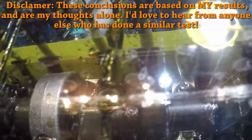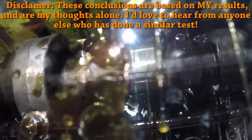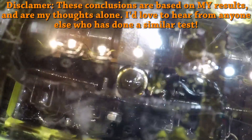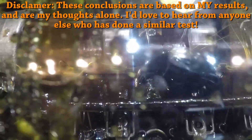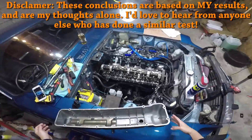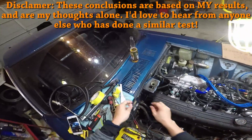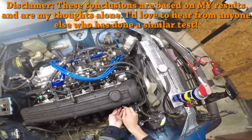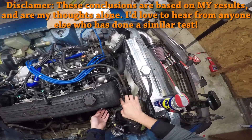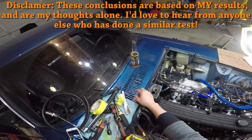So what I'm going to do is just leave it alone for now. I am going to order block-off plates for the cam tower so I can remove this pointless oil spray bar. But until that comes, the engine's been running fine before and it runs fine now, so I'm just going to slap the real valve cover back on and get the car running again. The conclusion is that the oil spray bar doesn't really matter if you install it or not — it's not going to do anything, but it also doesn't impact anything. The spray bar is taking a little bit of oil away from the camshaft itself, but the camshaft is still getting enough oil that it's really not a problem. So keep it installed if you want, or install block-off plates — either way, I don't think it's going to make a difference.